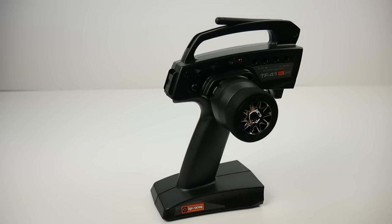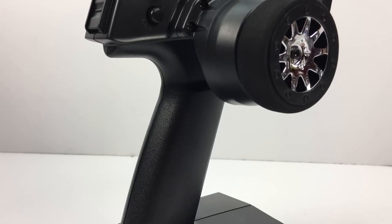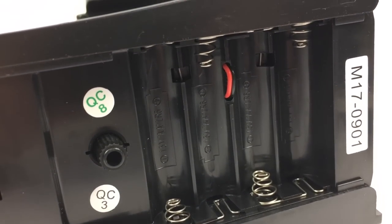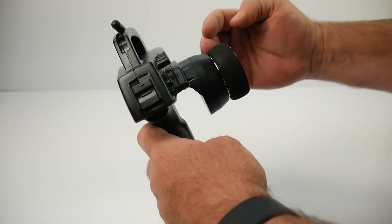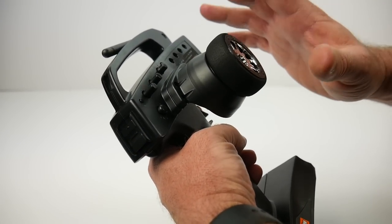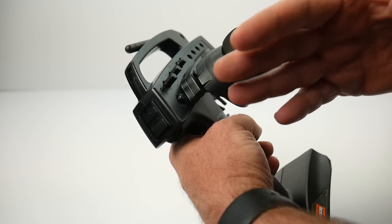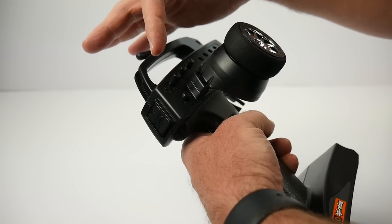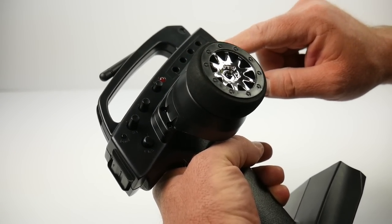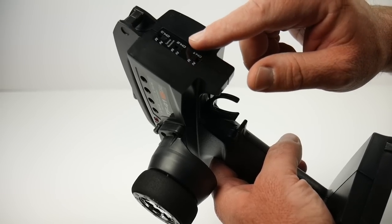What is special about this version of the HPI Racing vehicle is the TF41. I love the TF40 — that was the one on my original Sprint 2. Great remote out of the box. It takes four AA batteries, already included, and gives you a great feel in the hand. Nice foam wheel, good trigger position, and you get lots of controls right out of the box: on/off switch, a third channel for additional lights, a bind button, steering, throttle, and dual rates for your steering. You have endpoint adjustments for both steering and throttle, and switches up front to reverse channels 1, 2, and 3.